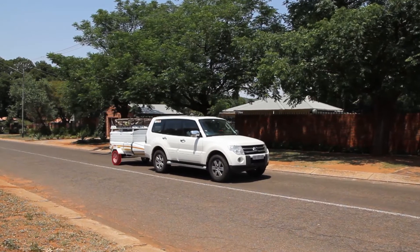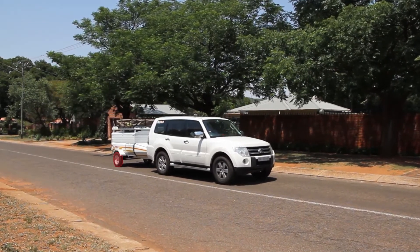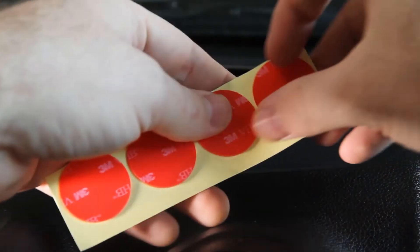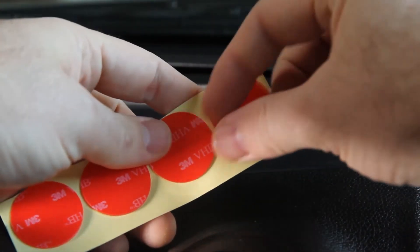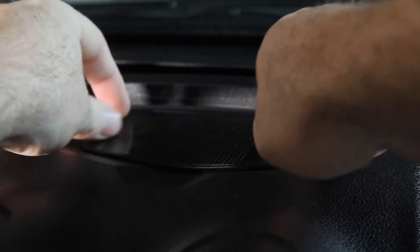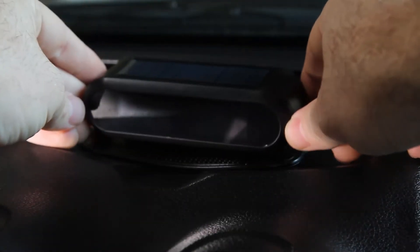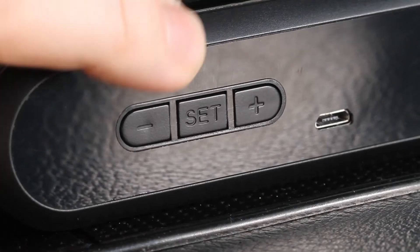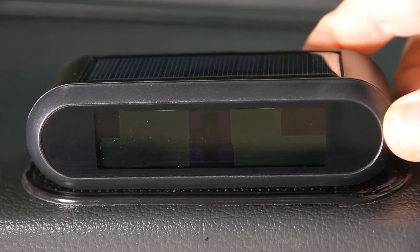These alarms go off if the tire pressure goes under the set low pressure mark or above the set high pressure mark. To install the system in your vehicle, use the provided double-sided stickers or the non-slip mat to place the wireless solar powered monitor on your dashboard. Switch the monitor on by pressing and holding the minus button on the back of the unit until the home screen appears.